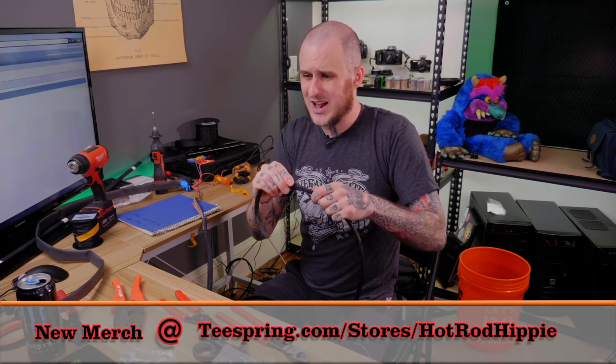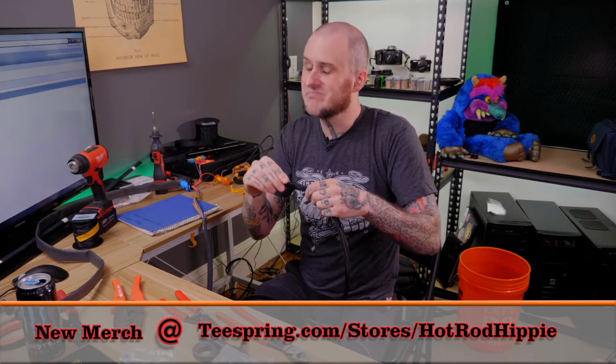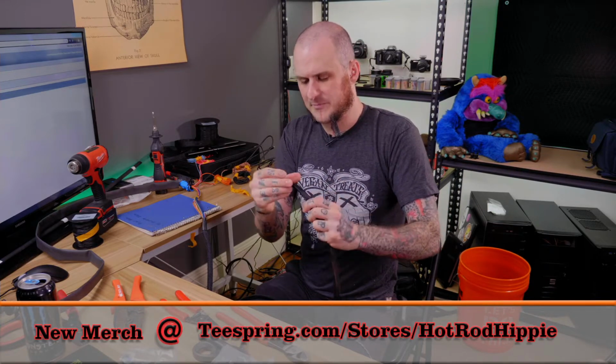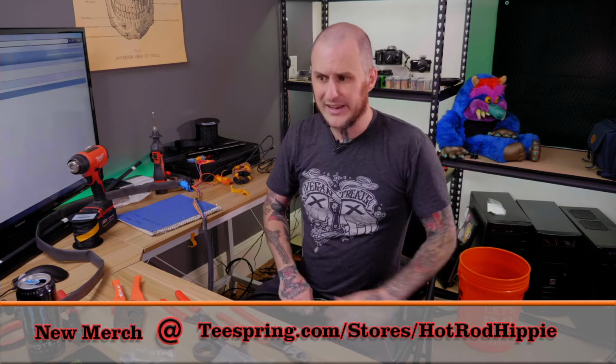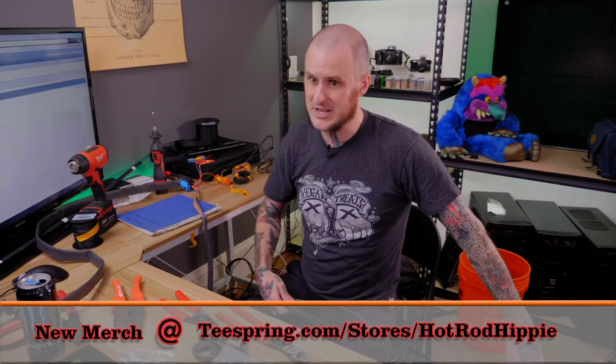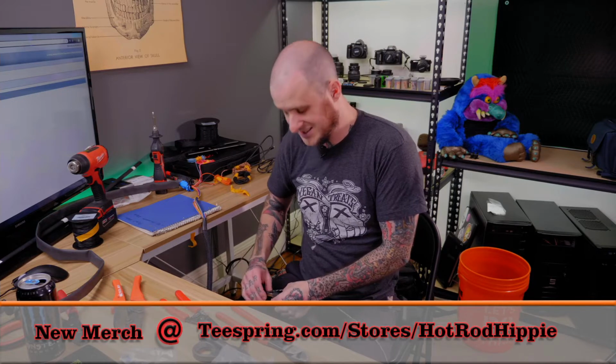Yeah, all that on DIY is the way I go. If you're not bringing in cars daily that you can justify a subscription for, it's the way to go. And as far as adding, you can just add that pin into that terminal and that'll be no problem. The functionality of the electric fans has to be turned on in the tuning software when the ECM is programmed, but that's straightforward, no big deal. For a tuner or for yourself, if you're trying to figure that out, honestly, it's not a big deal.